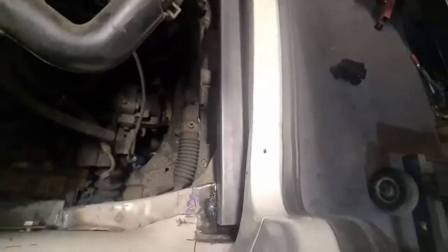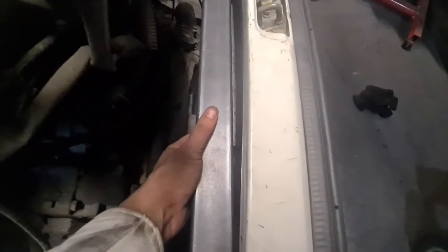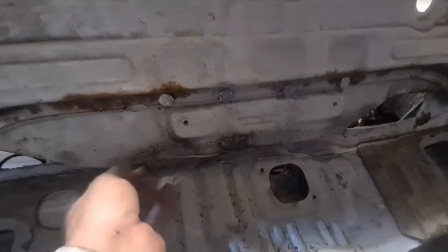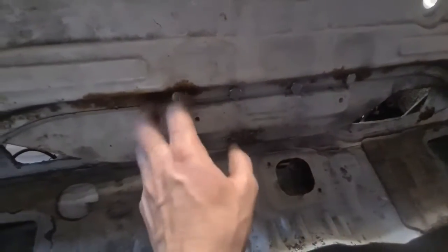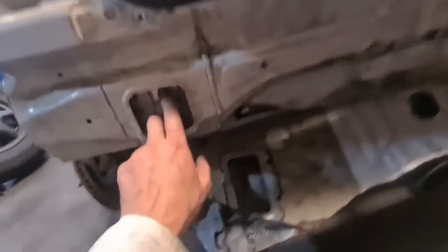I got this rear bar I was talking about in. It's just tacked for the moment. There's obviously a bit of a bow there, so underneath I have a bit of angle iron, and that just bolts through to there. So 1, 2, 3, 4. This is double layer sheet steel again. I will put a bracket plate on the back here when I've got some longer bolts, but that's just for now. Also, in these convenient little cubby holes there and there, I put a bolt that goes straight through, and that goes actually into the box section. So I need to finish welding all of that.